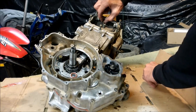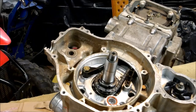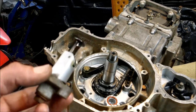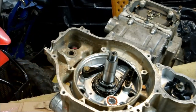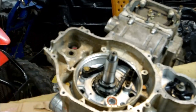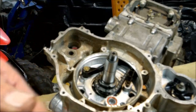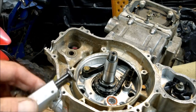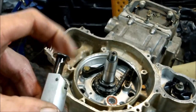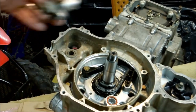Next thing I'm going to do is put the chain tensioner on. I'm going to show you my little trick. In my previous video, a subscriber mentioned something about the timing chain and chain tensioner. Always keep an eye on it — one of your timing issues could be that your chain is stretched. If you notice when you pull the tensioner out that it's all the way out and maxed out, there are little notches on there, then you know your timing chain might have some issues and you might want to replace it. I'm going to go ahead and take that nut off — there's a spring in there that will release the tension. Then I'll put that back together, put the spring in, and the tensioner in — that's going to tension up that chain really nicely.